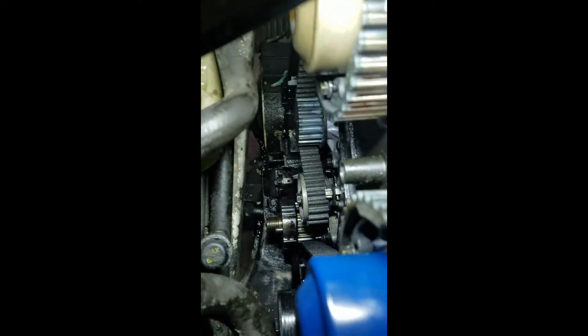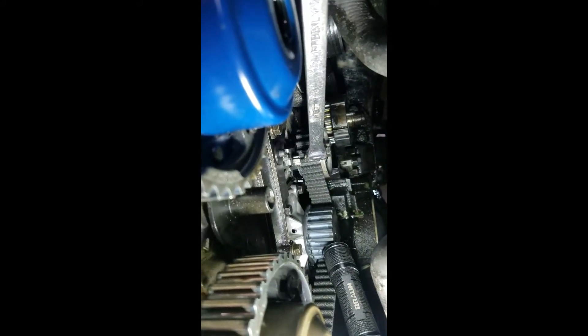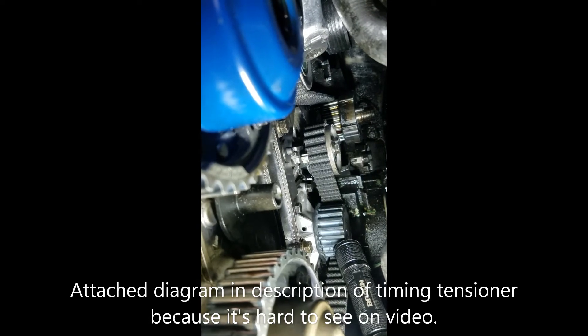For the belt, you set it a little different depending on the ambient temperature. But that's the tensioner right there. You want this to be right in between these two little marks — that's how it's going to look. There's a little hex right on the tensioner, and you want to stick a hex in that hole while you spin this 12 millimeter nut. If you get this nut almost all the way tight but not quite, you can actually adjust this a little bit, then tighten the rest of the way. You have to turn the hex by hand from the top so that you can see the position of the tensioner at the same time.